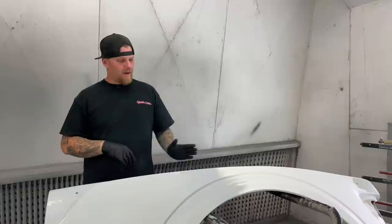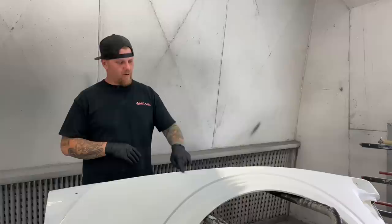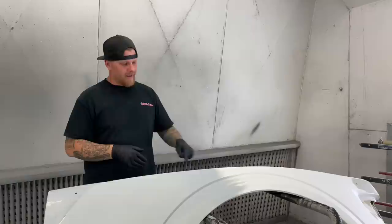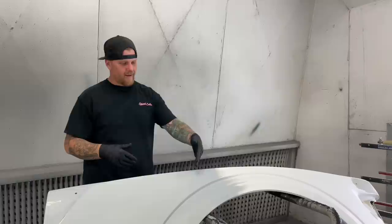You have the option of masking something and then priming, and what you're left with is a hard line. When you are sanding those lines, if you just wet sand and it feels smooth but it is a defined line, when you go to paint it — even though you can't feel it — it will show just a very slight deviation where you could see where there was a mask line. So it is important to wet sand out your line enough to where you won't see it. That's why you have the jagged edges on that area.